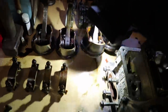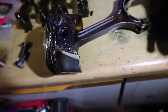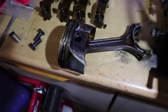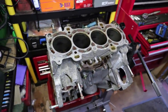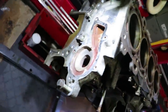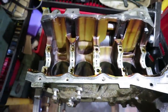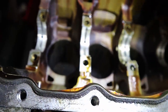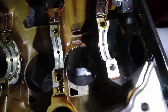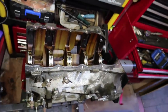The pistons look like they're in pretty good condition — definitely usable. The face of the pistons is fine, the rings all look okay, but since I've got them out I'm putting new rings on anyway. I'll clean all the pistons up, clean the block, clean the mating surfaces, and paint it to make it look nice. This is the inside of the other end — where the crankshaft sits — with the little oil holes visible. No cracks, the block looks in good shape. It'll be a good base to build back up.